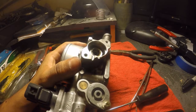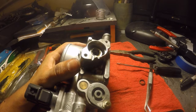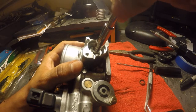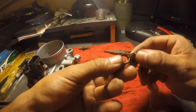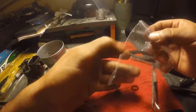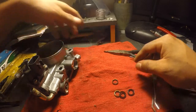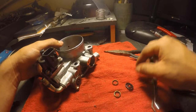After much fighting around and not being able to get it out with a flathead without doing any damage, I thought let's try a socket. I found out that the same 7mm socket I was using to remove the TPS can fit right into the seal and pry it out. See how much these things have gone through — those are the old ones and here are the new ones. You want to make sure you lube these up with some sort of grease — any all-purpose grease would do. I'm going to clean this up, grease these new shaft seals, and then we should be golden.